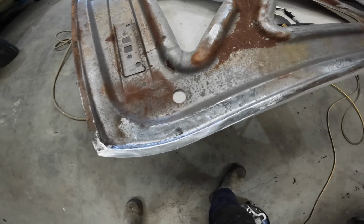First fit's really nice. And there we're applying sealer. We use a Wurth brand sealer, same sealer. Applying all the factory spots around the frame and a thin skim around the edge of the frame as well. Starting at the back of the boot lid, the bottom edge, feeding it in, fitting to the skin. Sits nice and tight in place.